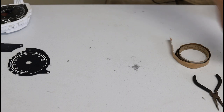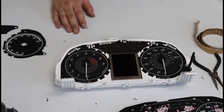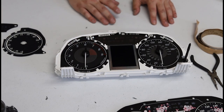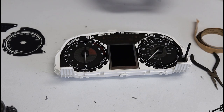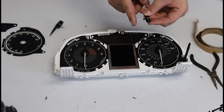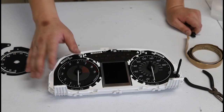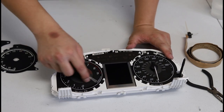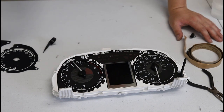The color version is a bit more difficult. If you've seen the GVB Subaru or the VA Subaru, you essentially have the exact same motors on this cluster. One of two things can happen: either you get lucky and the needle separates from the metal shaft without too much effort, or you get unlucky and the metal shaft starts coming up and out of the motor. To find out which scenario you have, rotate the needle with your finger — if you hear a lot of noise, most likely that shaft is going to come out. Don't freak out, just make sure you watch the tutorial before you do it yourself.